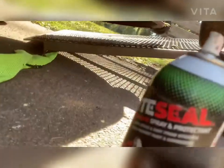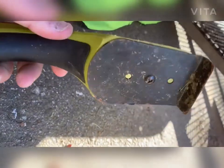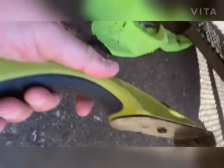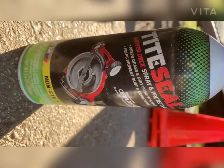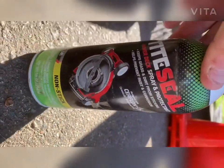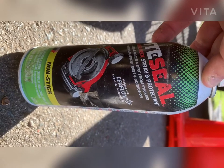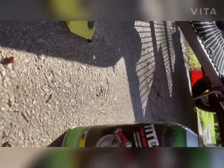I'll tell you the secret. After you use your deck clean-out tool — which you can buy from Grasshopper, an awesome tool everyone should invest in — clean your deck out, wash your deck out, let it dry, and then come back and use your mower deck spray and protectant. Essentially it's just a non-stick formula that you spray on your blades and your mower deck. You do this after everything's cleaned off and dried, when you're putting new blades on. This is what your deck will look like after — without cleaning it versus this, which is after like 60 mows.